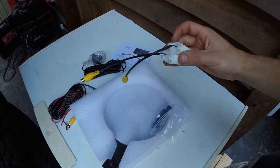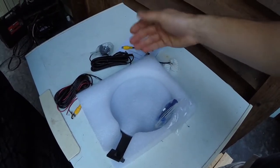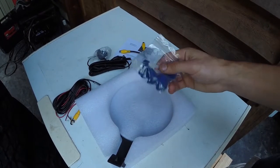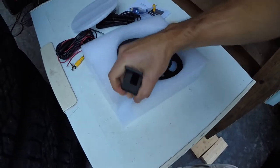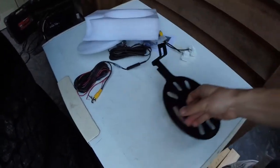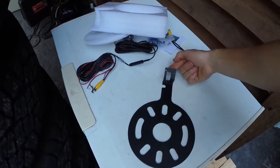Which jumper I need will depend on my unit. What I'll do is plug them one at a time, test with the camera, check reverse, and make sure it turns on. It also comes with a few splice cables, some zip ties, and the spare tire mount. That mount will just go right into the studs that are currently there, and the camera will mount up right through here.